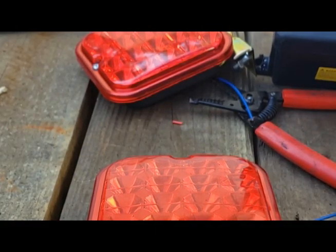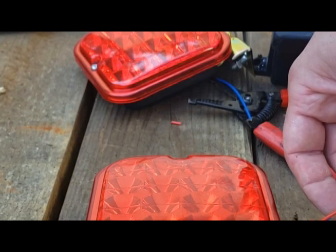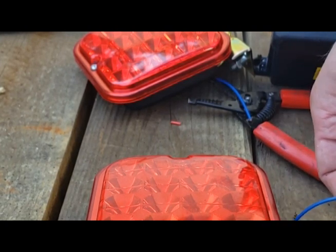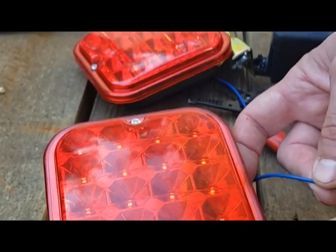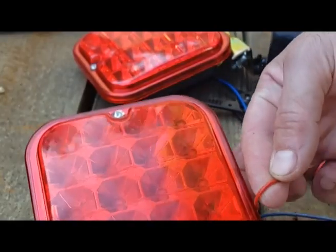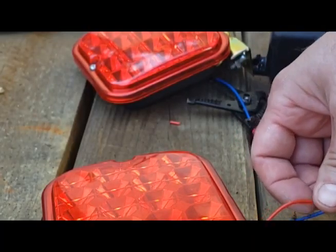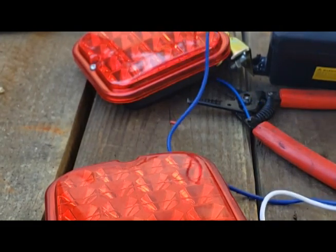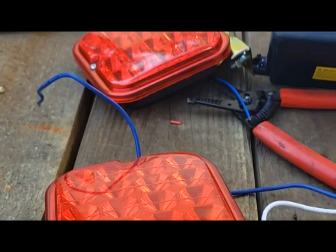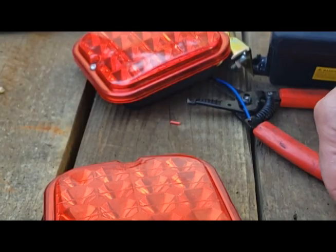Using the breakaway battery box, white is neutral — actually on this light, black is neutral. Red is power, and blue looks like the regular driving/running lights, while red is everything on super bright. I tried putting both together at the same time and it's no brighter than just red alone. So the red wire is my directional/brake wire, black will be my ground, and blue is the standing/running wire.